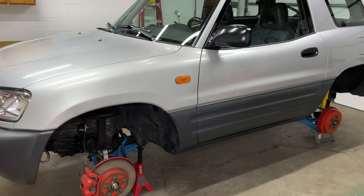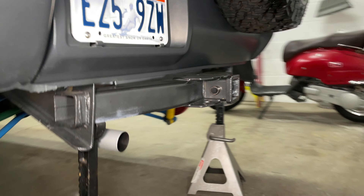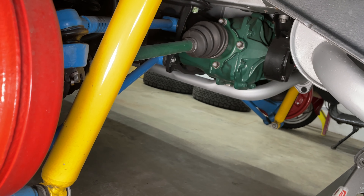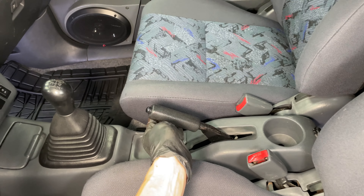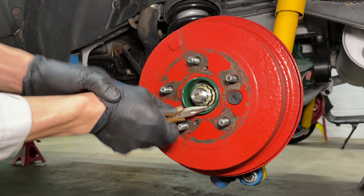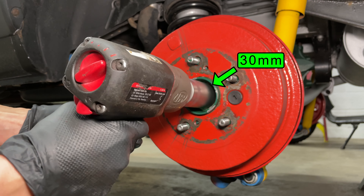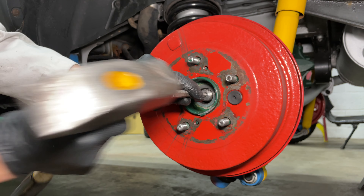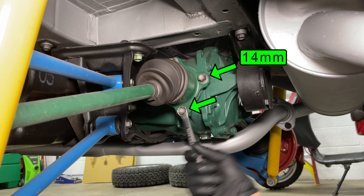Alright, I have my car in the air, wheels off. The front jack stands are on the lower control arm mounts, and the rear is supported by my super heavy-duty hitch. I'm going to make sure I can reach at least two of the CV axle flange nuts in the back, then turn on the parking brake. I'm using small needle nose pliers to pull the cotter pin out of the axle. Use a 30mm socket with an impact wrench to get the nut off, then use a punch with a sledge hammer to make sure the splines are loose from the hub. Now I can loosen the nuts that hold the CV axle onto the differential.